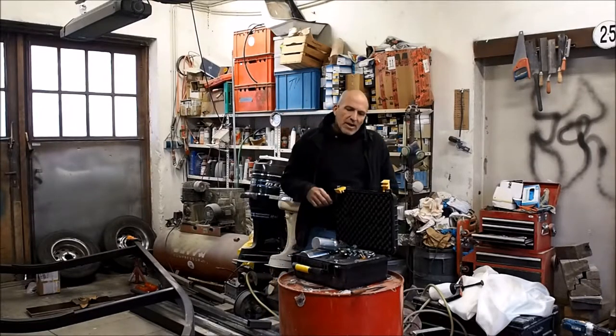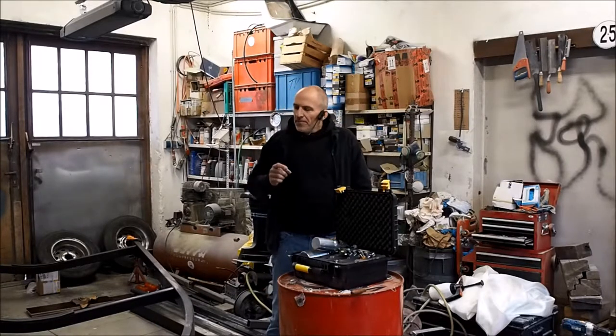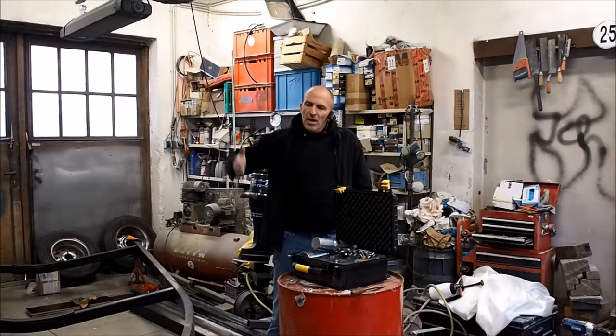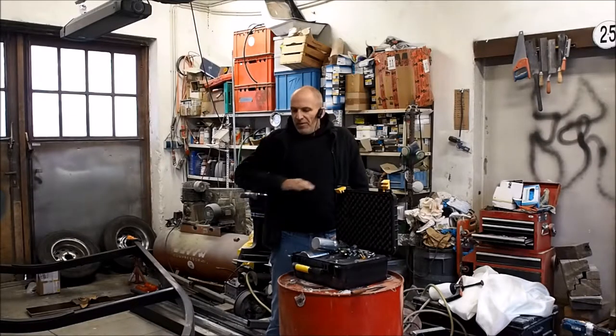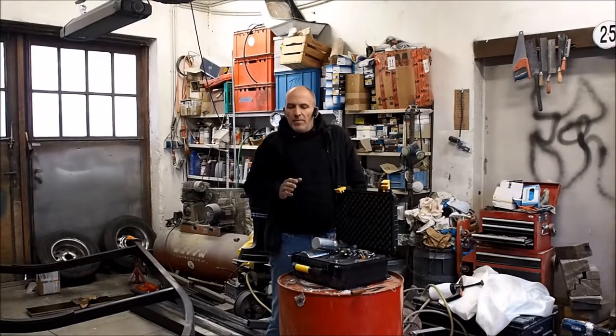And my experience is that if you do that, first of all, you build up really thick layers, because clear coat obviously builds up. It takes a lot more time to dry, and it's much more likely that you get runs, especially if you paint on the side of a vehicle, for example. If it's flat, it's not an issue, but on the sides, it's always a problem. So what you want to use is clear binder.